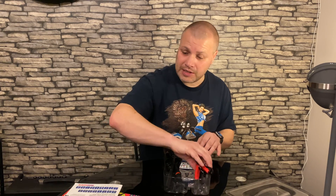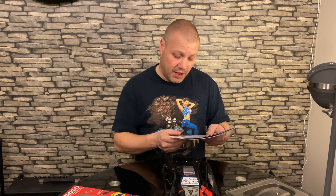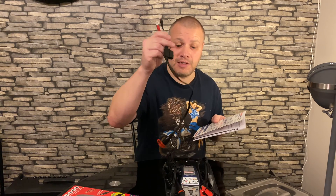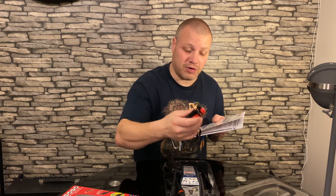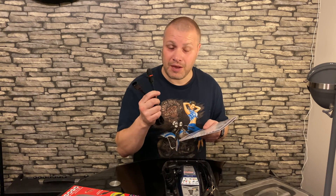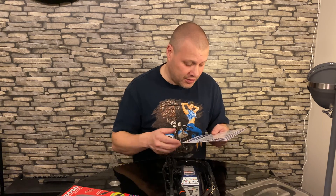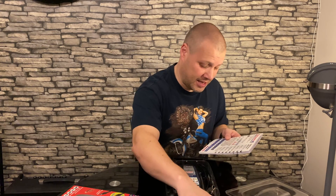So I'll explain why you get the crocodile clips by running through the two programmes. This is called the dual programme charger. You have a separate programme for whether it's a standard or direct connection charge. If you're directly connected through the cable to the battery, or you removed the battery and used the crocodile clips, that would be Programme 2. Programme 1 is the CANBUS BMW programme, which has eight steps in its charging cycle, whereas Programme 2, connected directly to the battery, has nine steps.